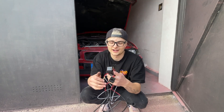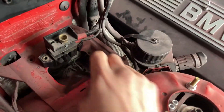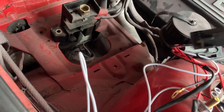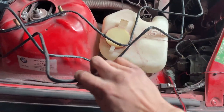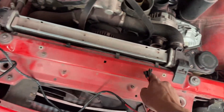Let me show you how I'm trying to connect it. The easiest thing is to remove this plastic right here — it's pretty simple, just small clips. You want to take the red wire which is positive and put it somewhere like here, then take the black cable which is the ground and put it right there. I'll zip tie the relay itself somewhere like here, and then run the wires for the angel eyes and connect them. The same thing is for the other side — I'll try to put the wires between here so it's hidden and not visible.